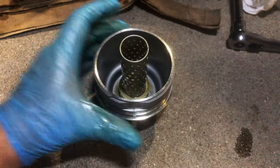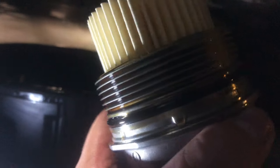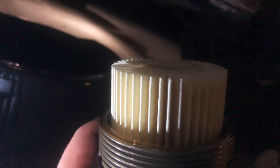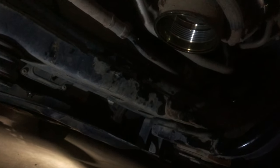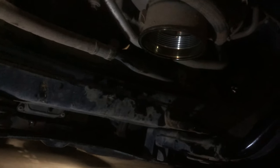That's it — everything's done. Put a new o-ring on; that's the location you want to put it, just before that bottom groove. Put the filter in obviously, and then at the bottom put in that o-ring as well. Screw it back in and tighten it — it'll make a seal pretty quickly, so don't worry about overdoing it. Once it's tight, maybe try a half turn but it probably won't go much. Then replace the bottom nut, clean that off, and that's it.